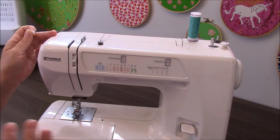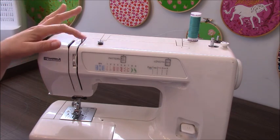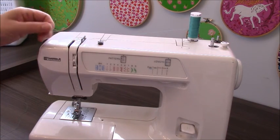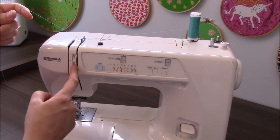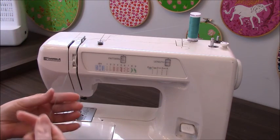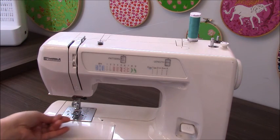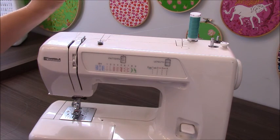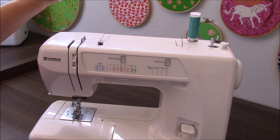There are similarities with almost all sewing machines, so it's rare to come across one that doesn't have these. The first thing you'll see is a stabilizing hook that brings your thread into alignment and runs it through an S-curve of sorts. We're going to take the thread down, swing it to the left and up, and look for a hook. This hook is really important — if you miss it, you'll get a total knot of thread when you start sewing.